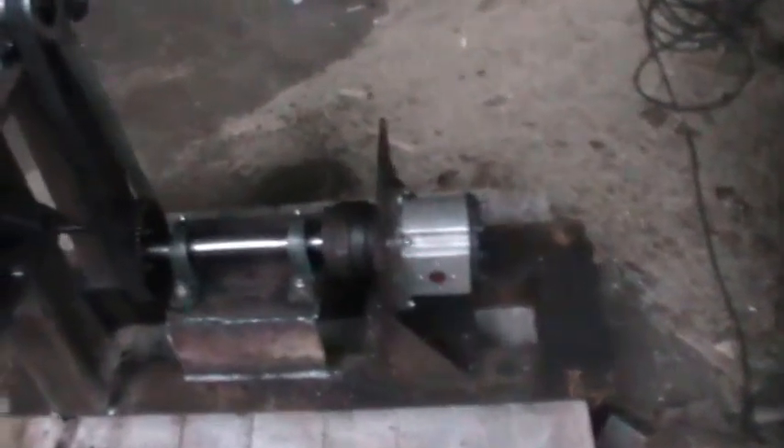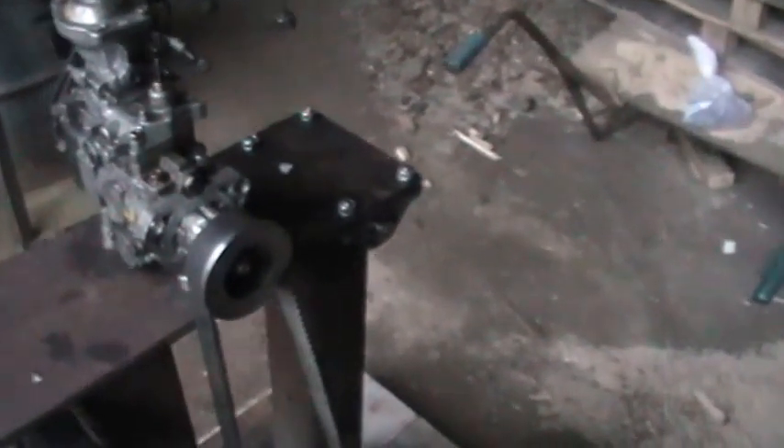What we've got here is my pump testing bench that I've been making — basically a hydraulic motor, a couple of pillow bearings. I turned that bit of shafting down; that's a bit of old Sherpa half shaft. There's a DI pump pulley on the end of the shaft that drives up to a Ford 2.5 DI crank pulley, because I wanted to run this motor pretty slowly — we've got to run that up to 2,000 rpm. I don't quite know whether I can get this going at that speed, and you're better off running them slower anyway.